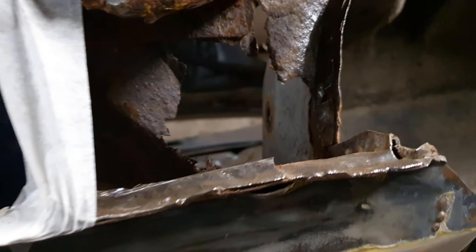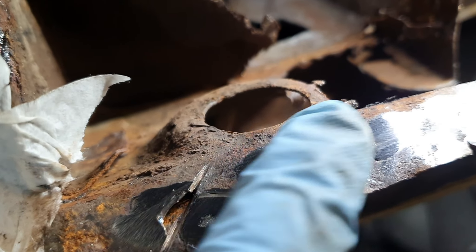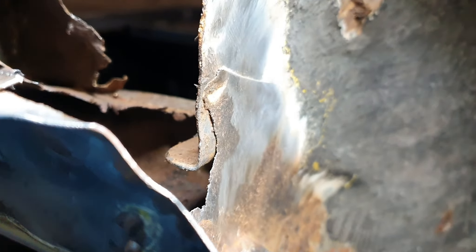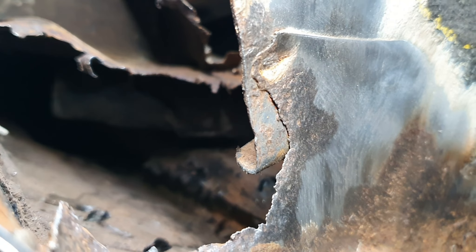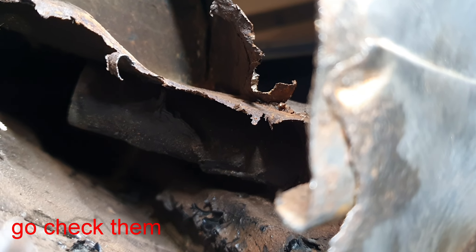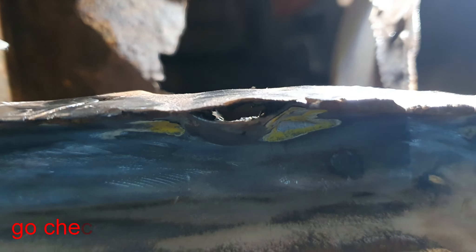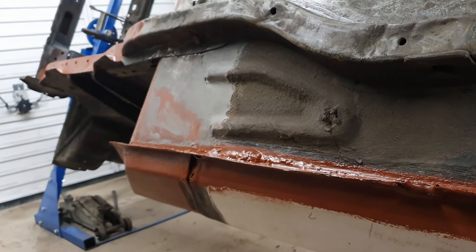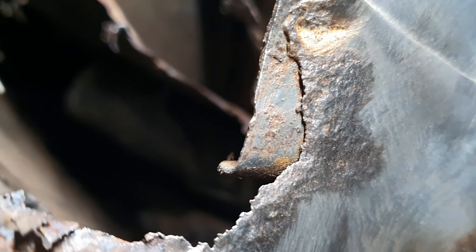Right then, so far I've managed to remove that piece that was here and also damaged a bit below, but we can fix that. Nice to remove that piece out the back and take that super crusty bit out. Now, Beard Canics Garage asked me what these little holes were — as you can see they go all the way through. That would have been behind that panel there, and it's for letting the water out of the sills. There should have been one at the front — oh, it's still there.